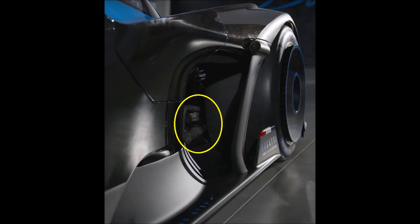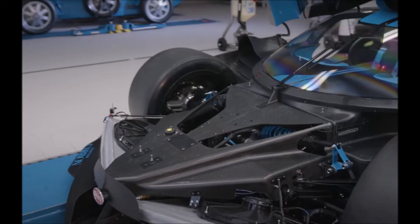Water pipes are running either side of the side impact structure. We can see it very nicely in this shot — there are two pipes either side and they run through the side impact structure of the car. The collectors of the radiators are in the upper and lower positions, and the upper collectors get thicker towards the center, which means that the connection must be on the center side, which is covered by the shroud on top and by the crash box.